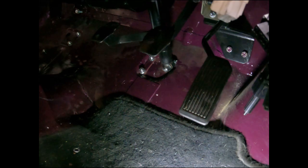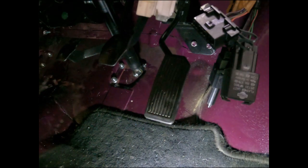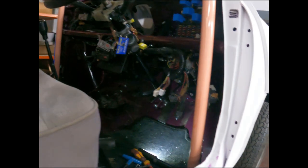There's no way you're going to push that steering column on with the bolt in, because the bolt goes literally almost through the side of the central shaft. Have a look at one, you'll see what I mean. You'll understand. But yeah, managed to get that bolt through. It was a real tight squeeze. So it all looks good. Just a bit more fettling with it.